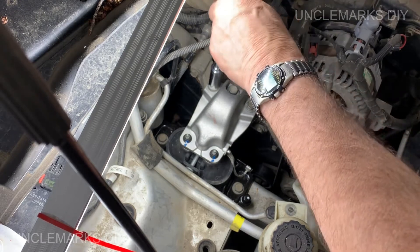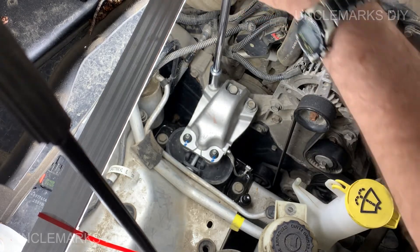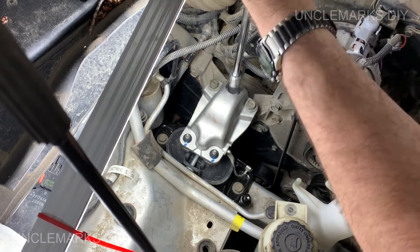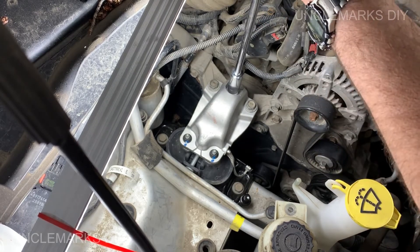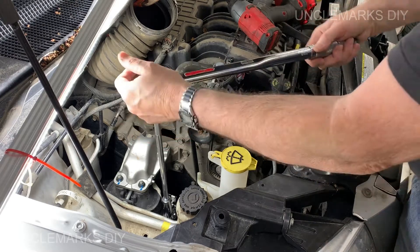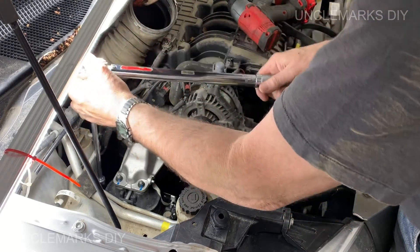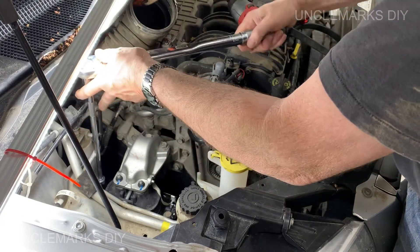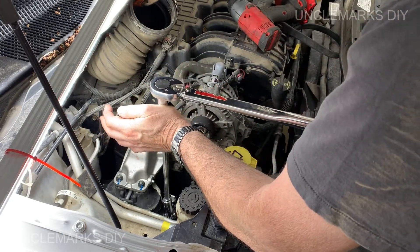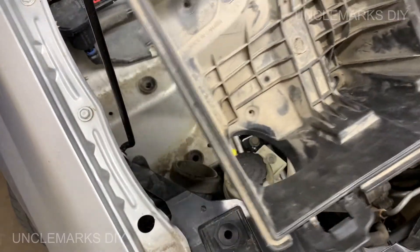It's not something that has to be measured like criss-crossing like head bolts - it's not going to be that important - but I don't want them coming off, so 40 foot-pounds. The mount came with absolutely no instructions and didn't come with the bolts either. It actually felt like a lot more than 40 foot-pounds, though I don't do this every day. The torque wrench isn't that accurate at low values.